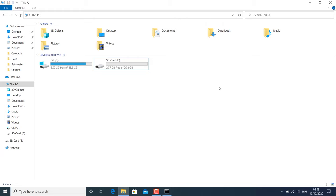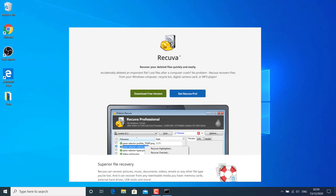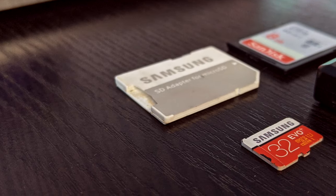After formatting the SD card you will lose all your data, but you can try to use third-party software like Recuva or any other software to recover your deleted photos or videos. I personally use Recuva — it is free, it takes time, but it really works. These were a few methods to fix a corrupt SD card. If it is not being detected even after cleaning the pins, there are some physical issues with your SD card — and there's not much you can do. Hope this helped — hit the like button, subscribe, and press the bell icon to get notified about new videos.